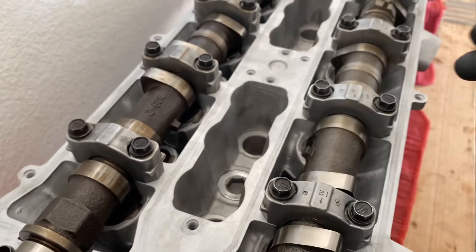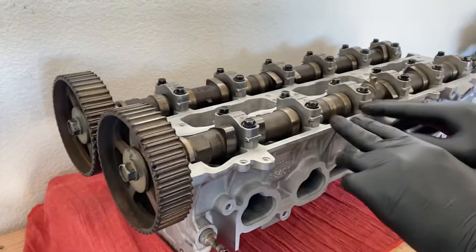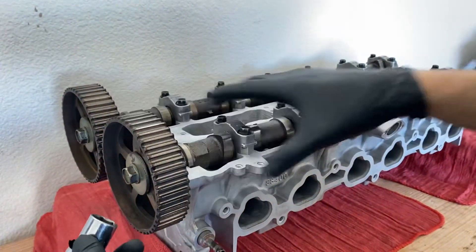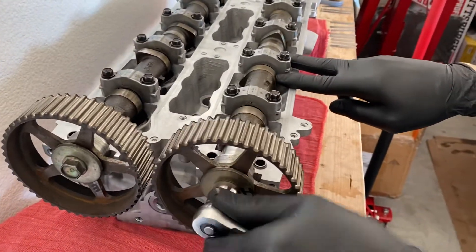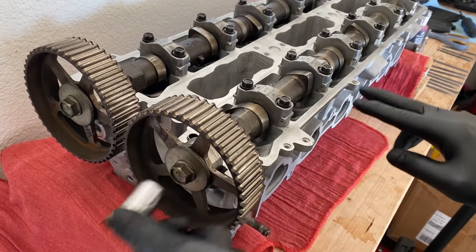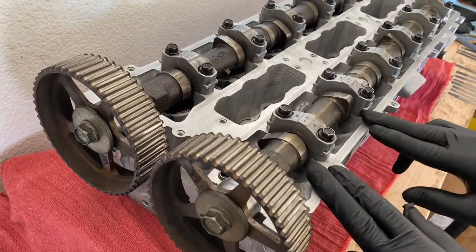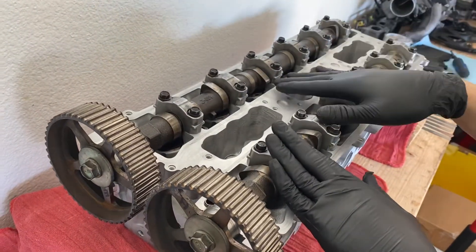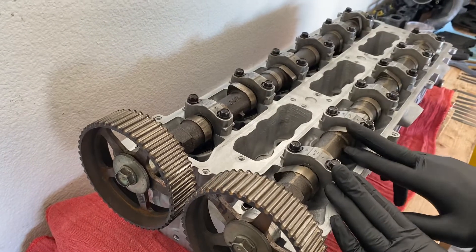These two are basically perfect. You'll want to continue this process for each of the shims. Grab your wrench to turn the camshaft until the next two lobes are pointing up at that 30-degree angle — right about there. Now I'm ready to do these two, check the clearances, write down my readings, and continue until I'm finished with the intake side. Then I'll flip it around and do the exact same thing on the exhaust side before I drop this into the car. That's basically it — just checking the valve lashes on my 1JZ head.